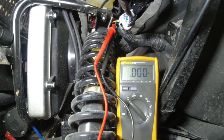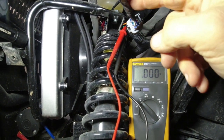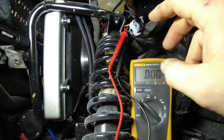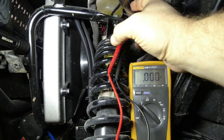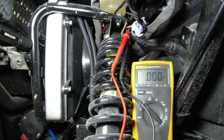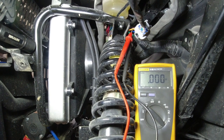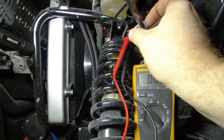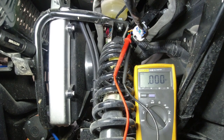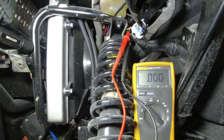And we're going to tie it in basically the same. Now, I could have stripped this wiring back right here, except we don't have the turn signal wire right here. That, and even if we did, I would go back behind the plug here. That way, say he puts this thing in a ditch and bangs up the front end, they have to unplug it and replace a headlight. They can still just unclip this, unplug it. Doesn't mess with our wiring at all. Makes it nice and simple for service later.